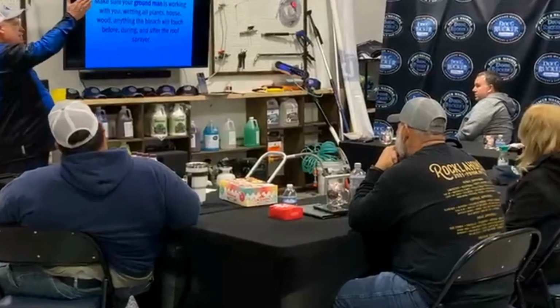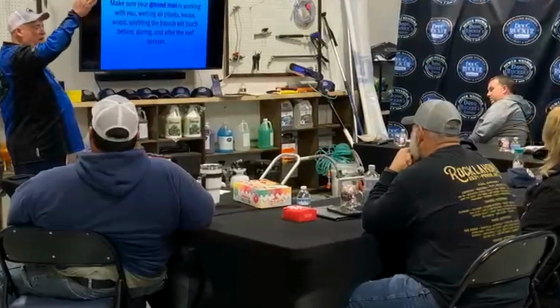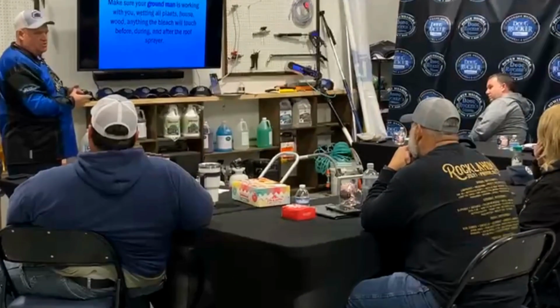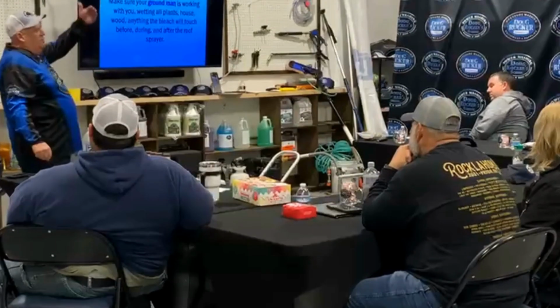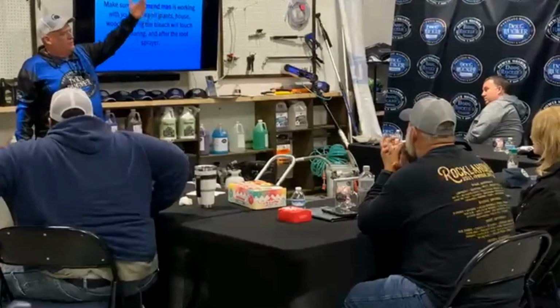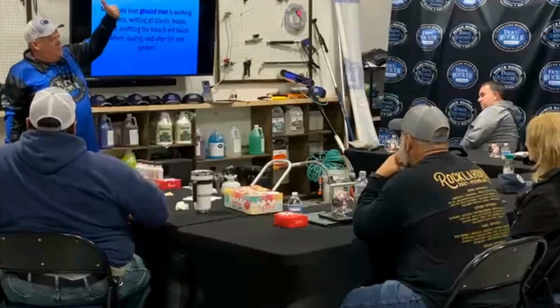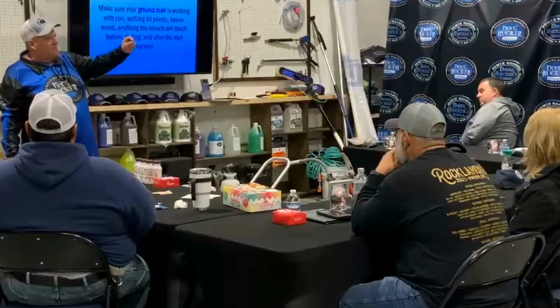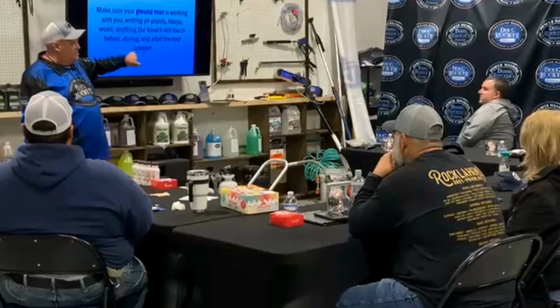If you're spraying like we did yesterday from the ground up, that mist can hit the gutters. So you gotta make sure those are staying wet. From the top, if you're spraying from the roof, top down, as you start getting closer to the bottom edge of the roof, it bounces to the top of the gutters and rolls down as little streaks.